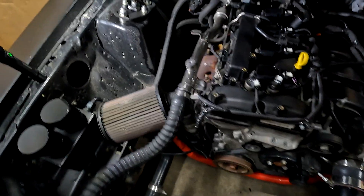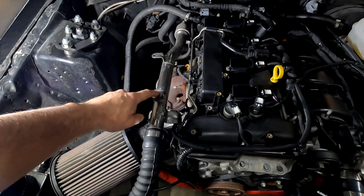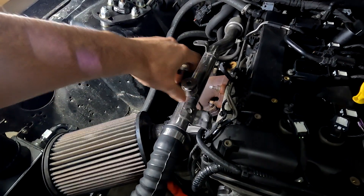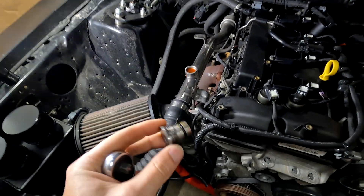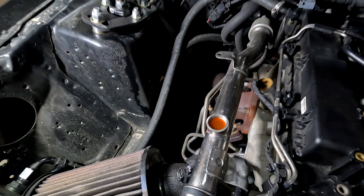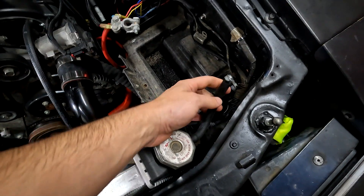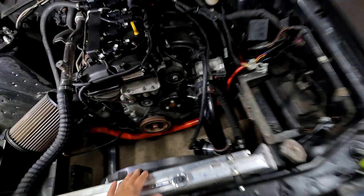With this setup, I fill my coolant through this port here — it just takes a quarter inch ratchet. It goes down inside there and it is an o-ring seal. You can see the coolant system is still a little bit under pressure, which is good — it's holding pressure. That's just a little o-ring seal plug. This will be the highest point in your coolant system. Fill it up from there. That's it, other than the stock heater cap and overflow line — it doesn't really overflow anything because the engine runs pretty cool with this setup.